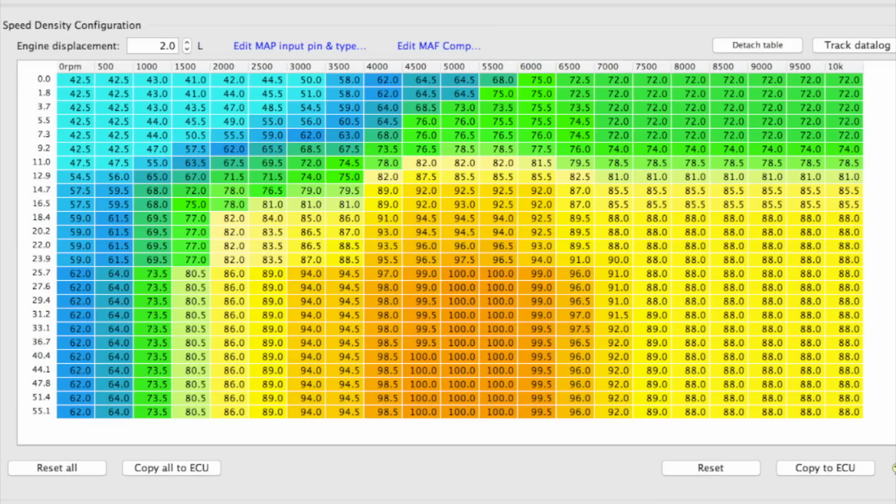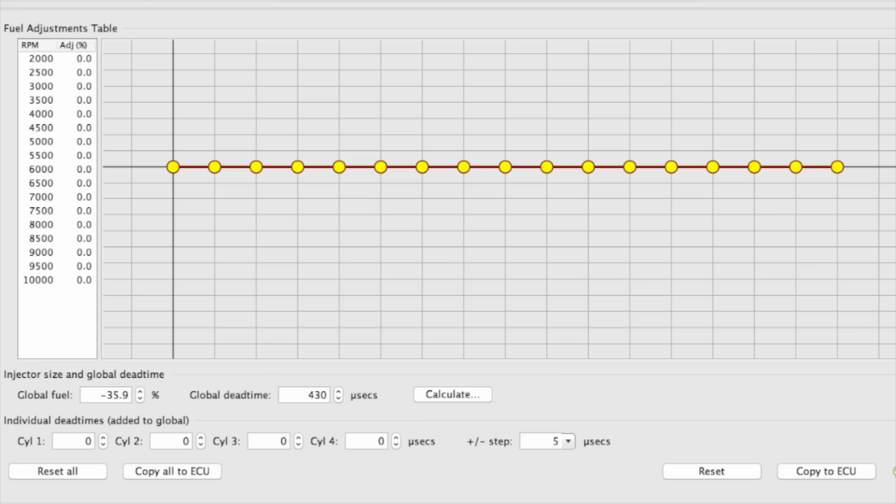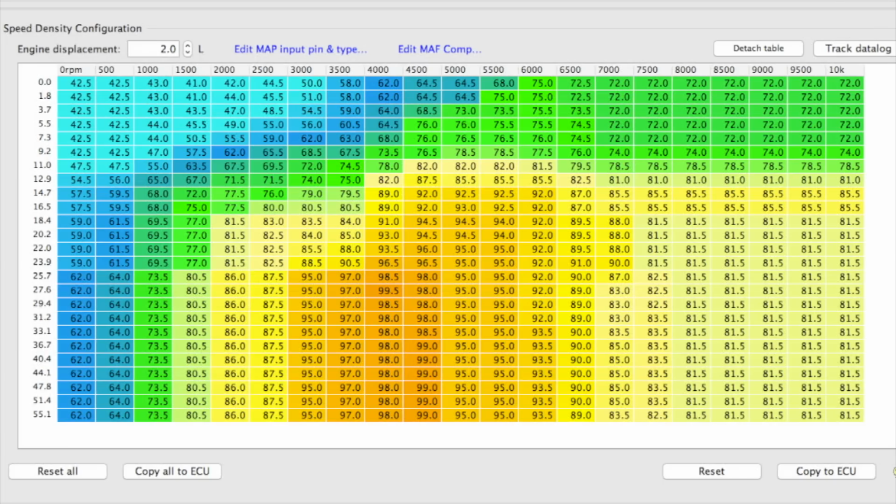Rebuilding this table to look like this took time, tools, testing, and 2 different people's heads over a period of several weeks. Here's what we ended up with. This is the kind of thing that's needed to make my ECU and water methanol kit share the same sandbox. So forget about those fuel sliders. In my case, the water methanol kit turns on at 25.7 on this table.